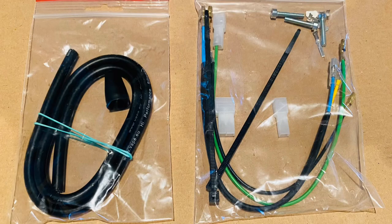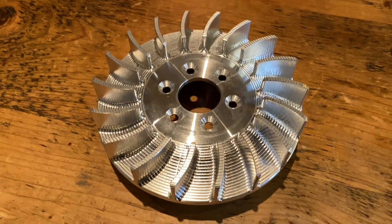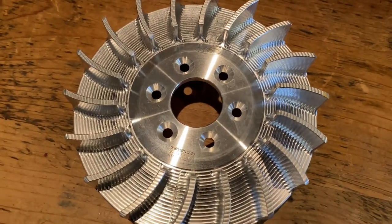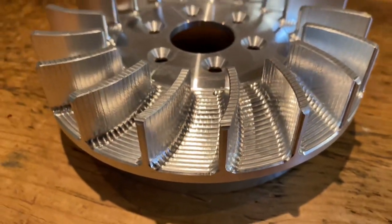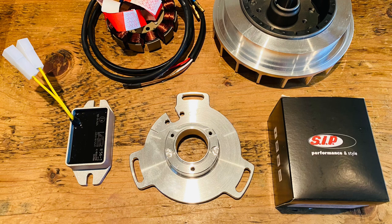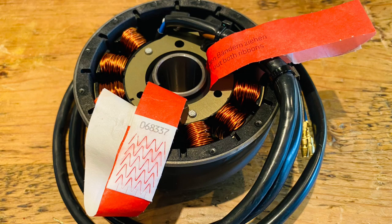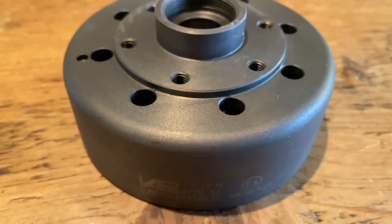Let's take a look inside the box. You've got a couple of packages in there with some electrical cable and wiring, which is useful material for when you're swapping ignitions over. The CDI module is available as a road version with static ignition or the sport version with variable. Next you'll see the 18-fin fan which fits onto the flywheel, with a six-screw fixing assembly to fit onto the boss. You'll also see the backing plate for the stator, the regulator, the box with the CDI in it, and then a two-part data plate for transportation purposes that comes seated inside the boss of the flywheel.